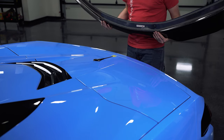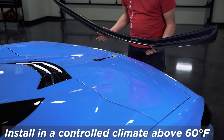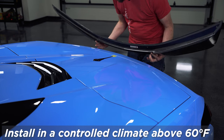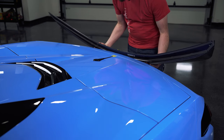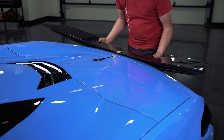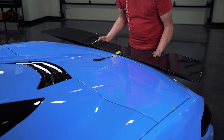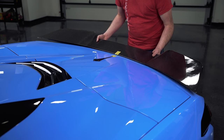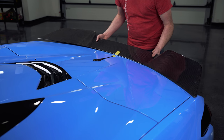Now we've got that all peeled and prepped. You want to use your hand here to space it up off of the car, and then be able to just kind of set it against there and line your mark up as you very carefully push it onto the car. Make sure to hold it up high enough so the tape doesn't begin to stick prematurely.